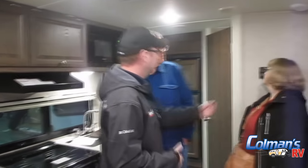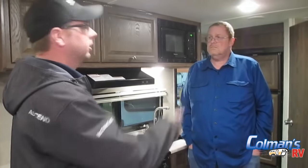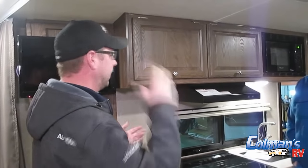You do have a regular fan — open your windows and turn it on to stir air around. It also has heat built in. When you turn the heat on and go to shut it off, sometimes you have to give it four to seven minutes because it has a cool-down cycle on the furnace fan. So if you know you're packing up and leaving, turn the furnace off and give it time before you're traveling home. You also have power outlets spread throughout the camper. The power outlet in the bathroom is a GFI outlet — all outlets are tied together. If your outlets aren't working, always flip that GFI switch in the bathroom to make sure it didn't trip. A wet curling iron or similar item could trip that breaker.